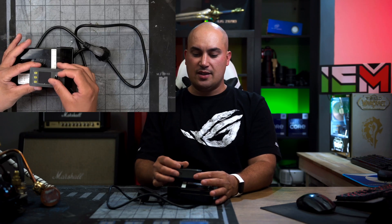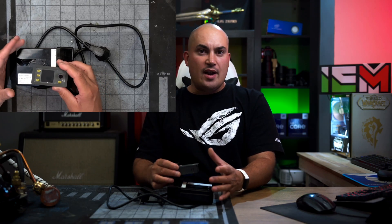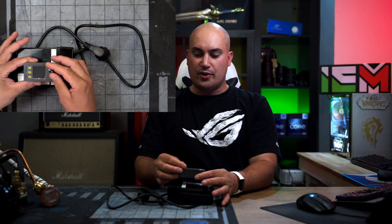This is a pulse generator, so I can generate a digital signal to control the logic board and the compressor — like a manual overclock. It's like the boost of a CPU or GPU, dynamically changing the compressor speed based on load. With this I can manually control the speed: set it to minimum for almost zero noise at idle, or crank it to maximum for benchmarks and rendering. I'm going to make a switch to go from automatic to manual settings and control the compressor with these tiny things.